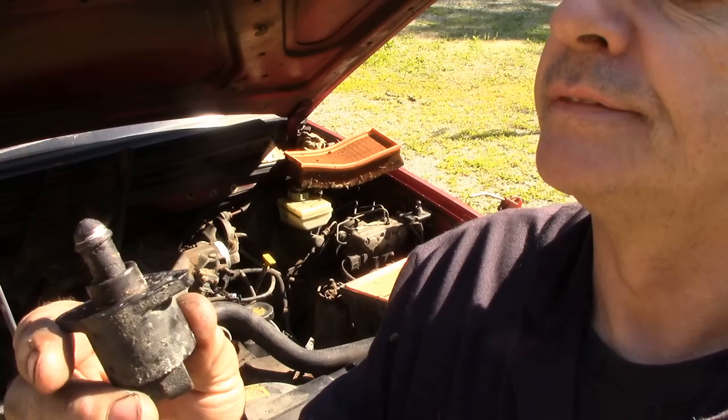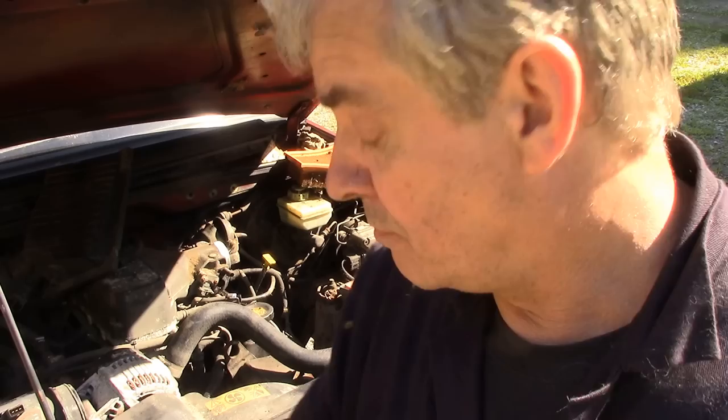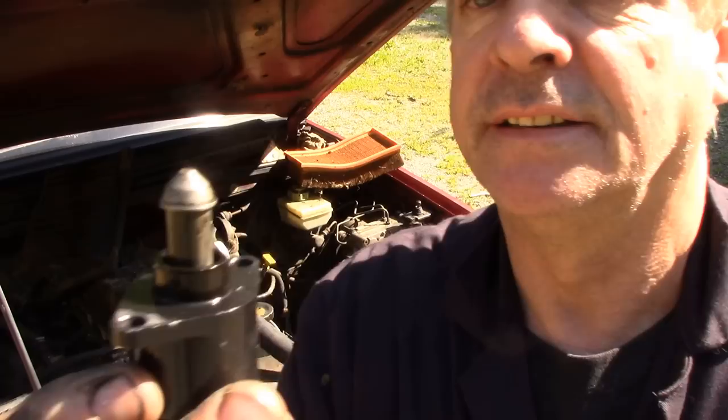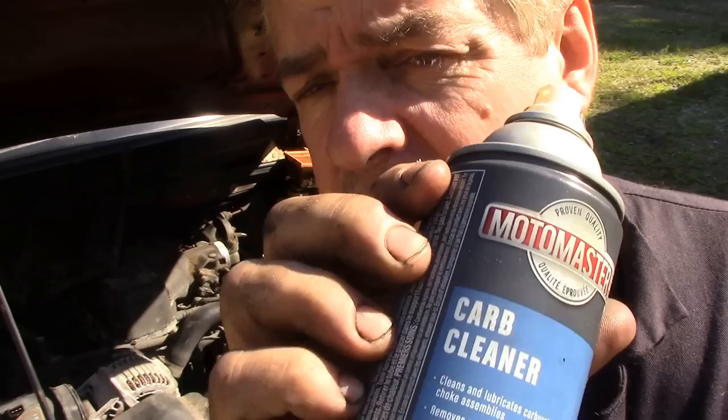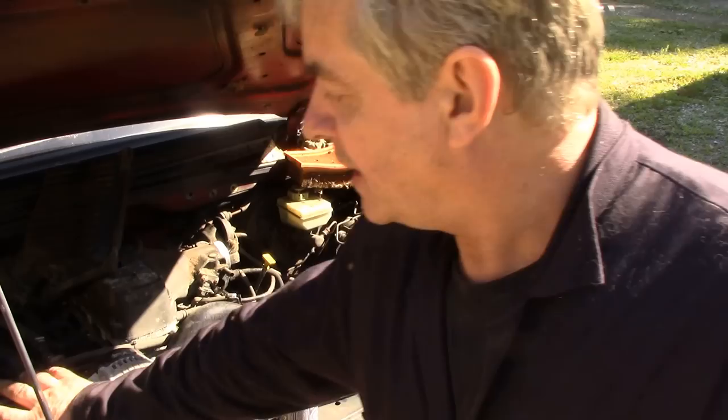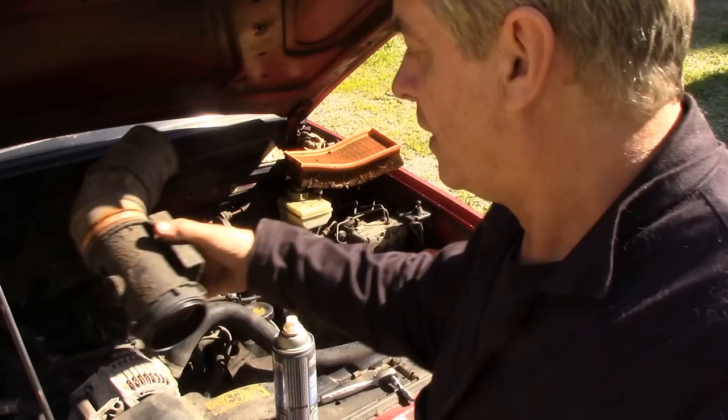I started to clean up all the bits. This is the old air valve — you may be able to see that one side is worse than the other, so it hasn't been sitting even, which is no great problem because I have a spare one here. I'm going to put that one on. I've cleaned them all up with carburettor cleaner — not brake cleaner, brake cleaner isn't as good on carbon, but carb cleaner is really good. I've cleaned out the mass airflow sensor, blown it all out — that should be good.